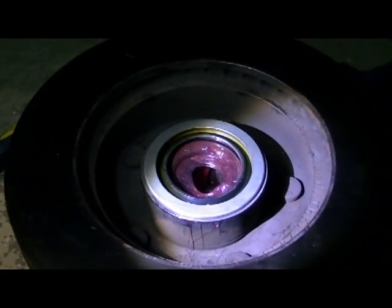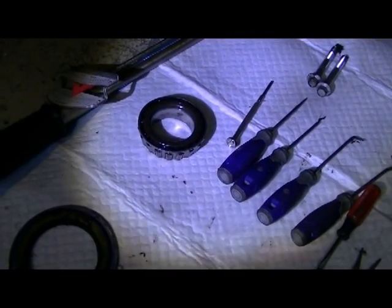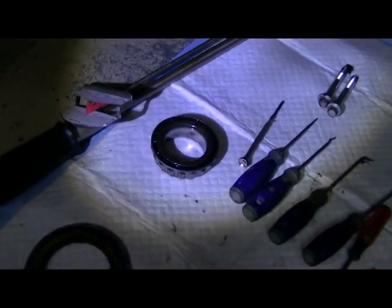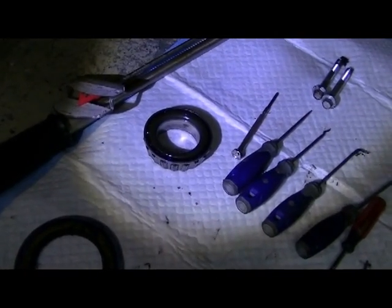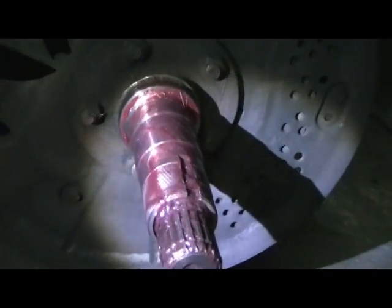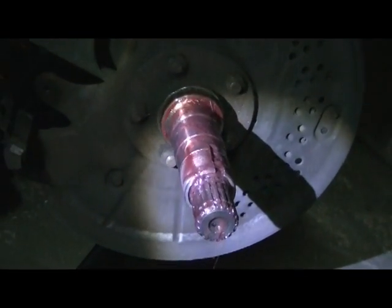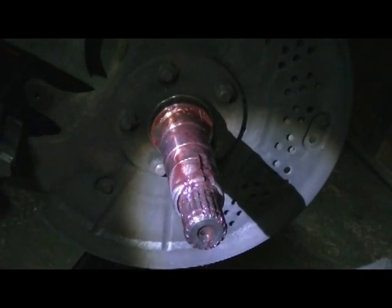So we're looking good on that bearing, and then I'm going to go ahead and move on to the outer bearing over there, which is smaller. So if you get your bearings mixed up, just remember your inner bearing's bigger, outer bearing's smaller, but you can't screw it up because the outer bearing won't fit where the inner bearing goes, and so on. Got the shaft cleaned up there to spline. I went in and put some grease on there too, so it can receive the hub real nice, and we'll be back. Go ahead and take care of that outer bearing and see what we got.